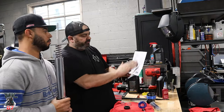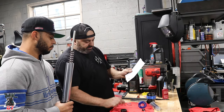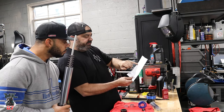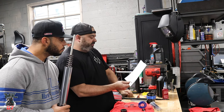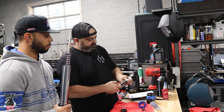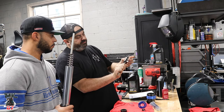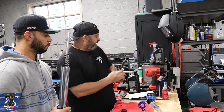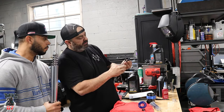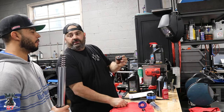You're going to install the cup, and they give you two different preload tubes. For a Harley with fairing, you're going to use the guide ring and the 12 millimeter preload tube. This one's 20 millimeters, this one's 12 millimeters — use the shorter one on these bikes. It only goes in one way. Now here's where you need the second special tool. This tool goes in between the spring and that nut to keep it in place so we can reinstall the cap.